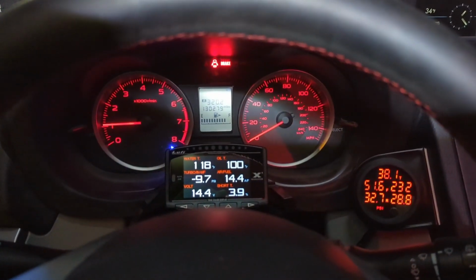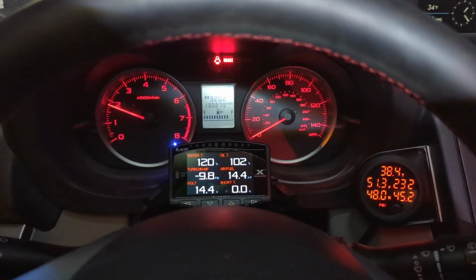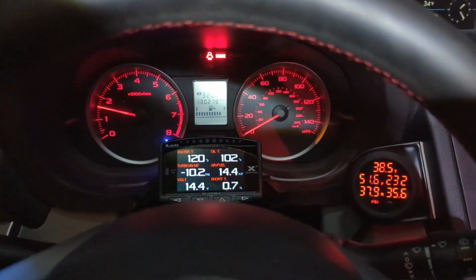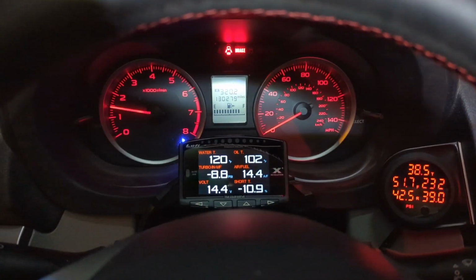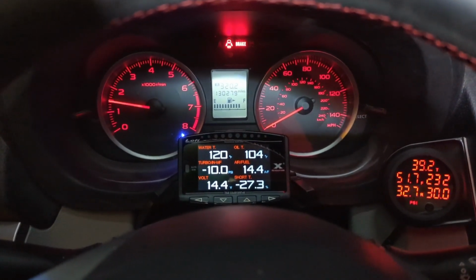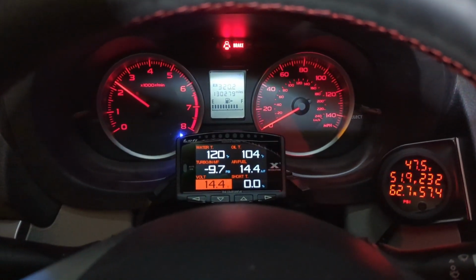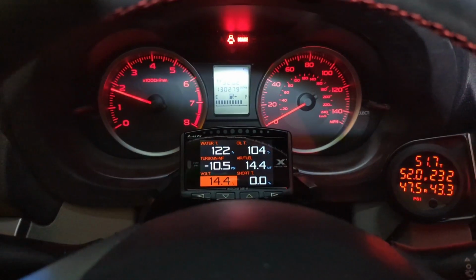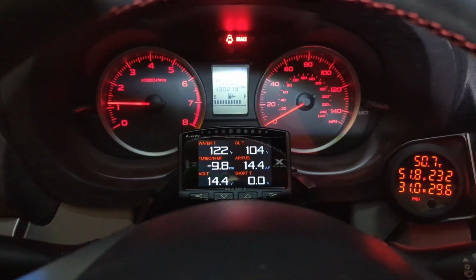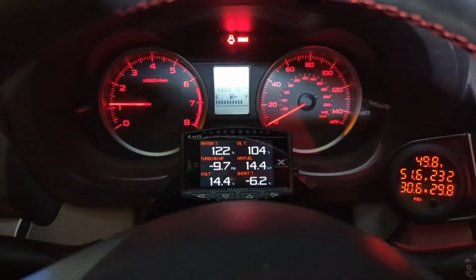So I've just started it up with not enough shims to fully space these guys. So you can hear the Supercharger running even when it should be off. And when I force it to use the Supercharger, well, this amazing sound. So, not great.